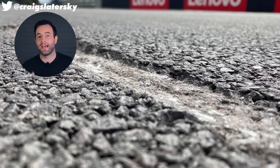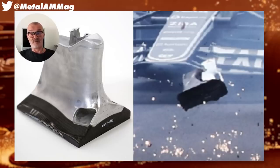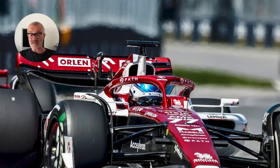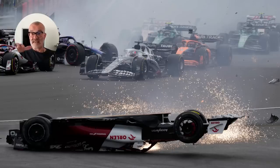There was a massive vertical load going straight into the monocoque. Then the skidding across the track produced a massive sideways load. At this point the car was spinning, so this load was in a direction that was constantly changing — essentially trying to pull the roll hoop off the car. And indeed, the roll hoop did depart from the car. From that point, the driver was protected by the front of the halo, the rest of the monocoque, and the rest of the car at the back. With the car being rear heavy, it tended to tip upwards with the nose up.